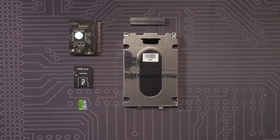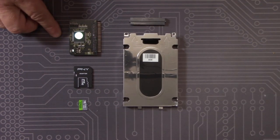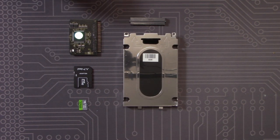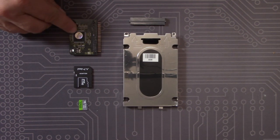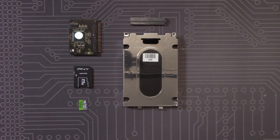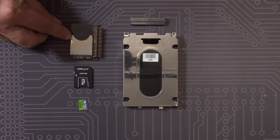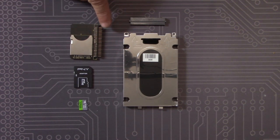Let's get back to it and see if we can teach this old dog a new trick. Going this direction, there are just a few pieces of hardware we'll need for this mod. First and foremost is this IDE microSD card adapter. Unlike older compact flash cards, SD cards aren't compatible with the IDE standard, and this little board has a chip that handles that interface for us. We picked this one up on eBay for just under $7 with free shipping. On the other side of the card, we have a slot where we insert the microSD card and our pins for connecting and plugging the board into the computer.